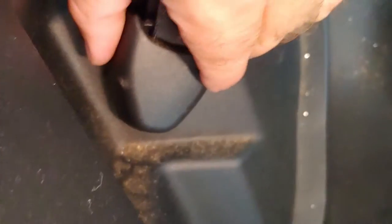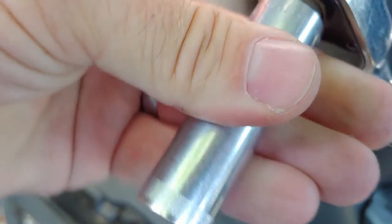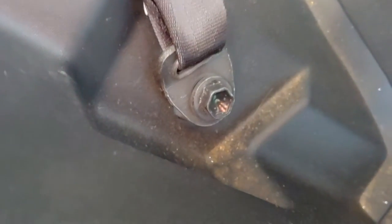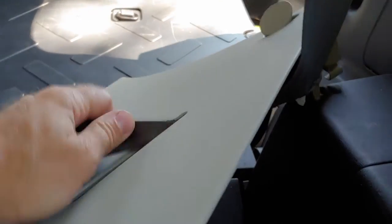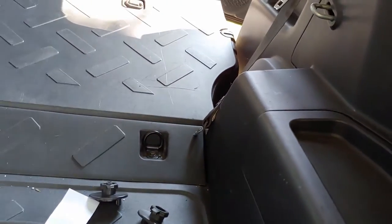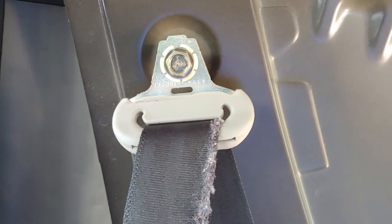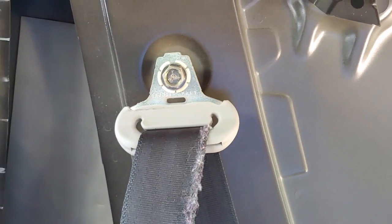With the seat flipped up but the back not down, you can get to this bit. This trim piece just kind of pops off. This bolt is not a 10mm — that's a 14mm. I'll take that off. Disconnected. I can walk the belt through the slot. Get that panel out of the way. Then I'll take this guy off — it is also 14mm. The other one was pretty difficult, I almost went and got a breaker bar. The reason it's difficult is because it has this extension as part of the bolt, so it kind of flexes when you go to turn it — it's harder to break loose because it flexes instead of putting pressure where it needs to be.